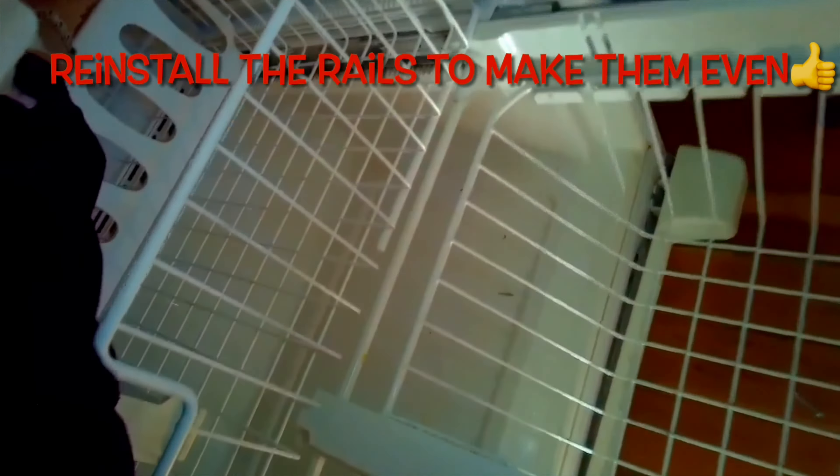Lastly, we put in the quarter-inch screws in the front. There's a little trim piece I had to take out to unlock that left gear side, so I just put that back in. We've got a nice alignment, no more leak. I'm putting those quarter-inch screws back in on the front of the upper rails at about 45 degrees — zip that one in, that locks that rail down. Do the other side, lock that down, and then you're done. The door closes really well again.